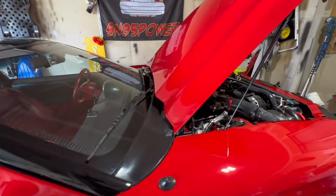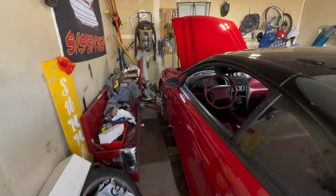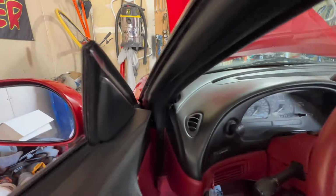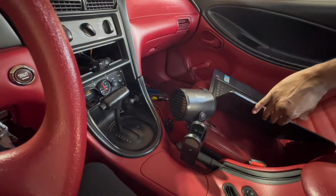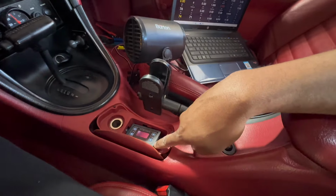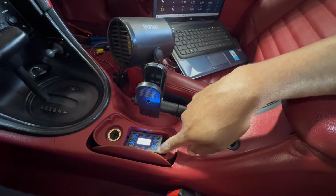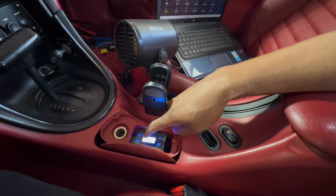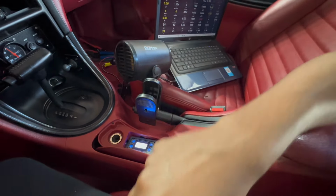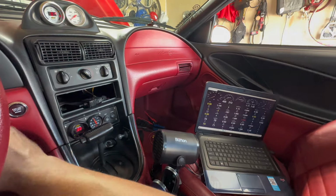Let me show you my little setup. Also, it helps to have the car in the air when you burp. Twist it. For right now, I need to get some Velcro and tape this down, but the fans will not turn on until the CCRM gives them a signal. So let's get this temperature up to 196 and we'll start playing around with the fans.